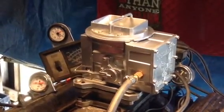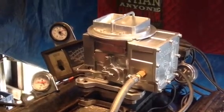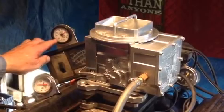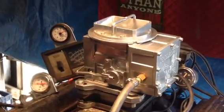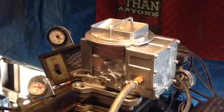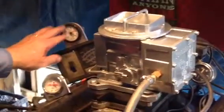Now, you're going to notice — I don't know if you have an air/fuel ratio system in your vehicle or what — but this thing's going to run probably about 10 parts. It's going to run rich compared to the normal carburetor that you would drive it on the street. You try to thin it out any thinner than that, to where it runs thinner on the idle, then it won't take the gas and perform at the other mid-range.